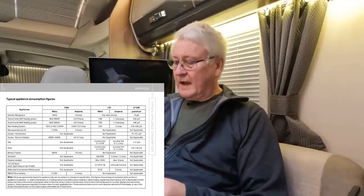I've switched the electric hot plate on and we're using 13.9–14 amps now. The heating has settled down a bit but we're still running close to the maximum. It's probably sensible to step the electric hot plate down to the second setting — and if we look at the power now, we're still using 13 amps but at least we're not going to trip the supply.